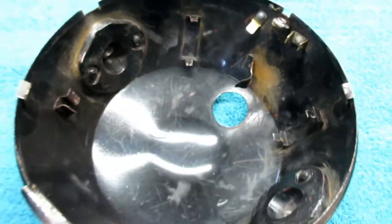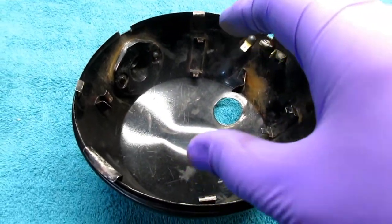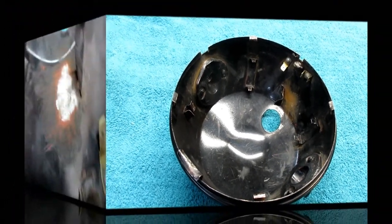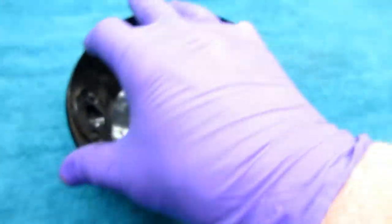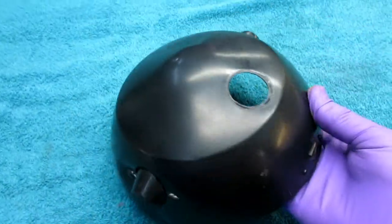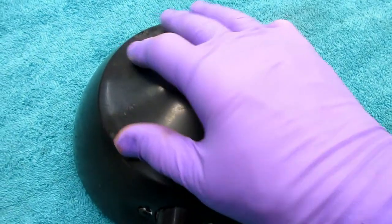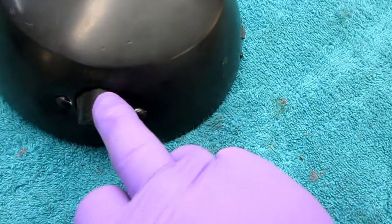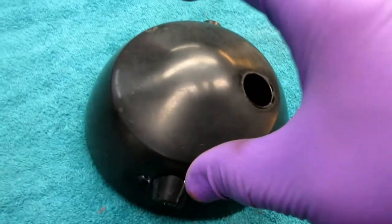You can see underneath — I was able to get a lot of the rust out. That tool is really good. I want to keep grinding until I can see I've got all the rust off. Just for reference, this red you see is red primer, not rust — I've got all the rust off and the surface roughed up. The inside of the headlight is now ready for a coat of primer. But first I want to sand this down. If there's any place rust is coming through — and I think that's one of them — we've got to get that part down to bare metal. The one thing we cannot do is paint over rust.